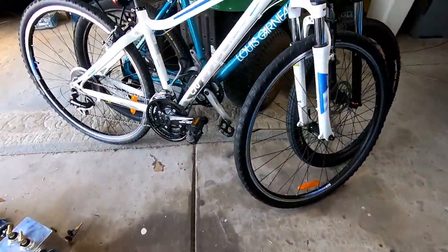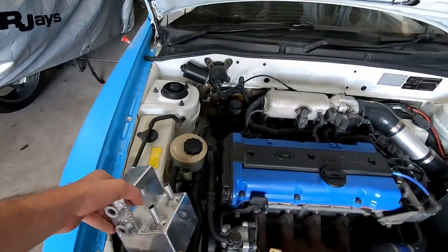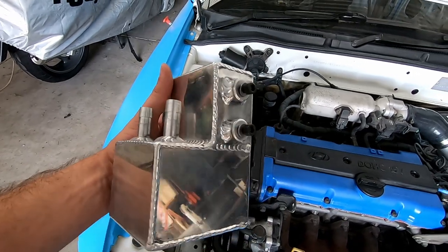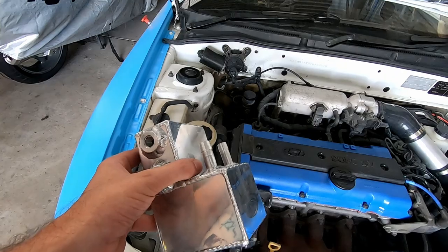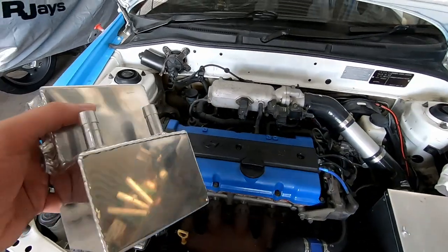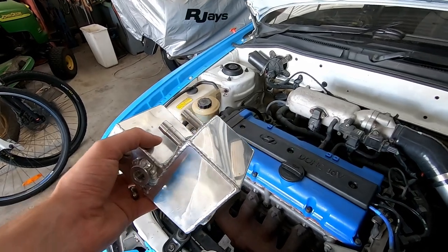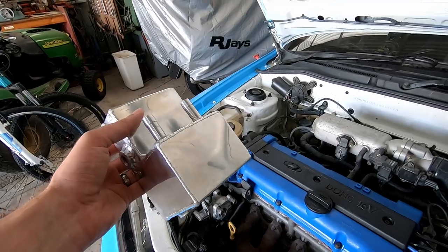Here is the original plan. I bought this guy, which worked out really well — it actually fit in there perfectly. I had all the fittings sorted out for it, had two little filters, had the lines. And then the day I was coming to fit it up, I read a post that said you need a two litre oil catch can — part of the CAMS regs. I completely missed that because I was looking at the XL regs and didn't realise it was like a general regulation. So that kind of sucks.